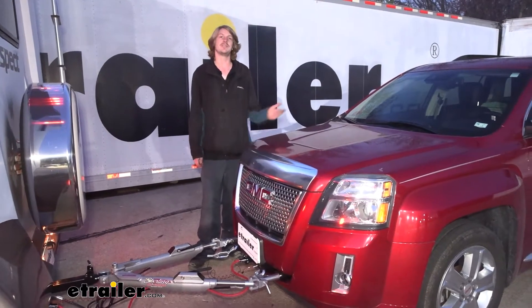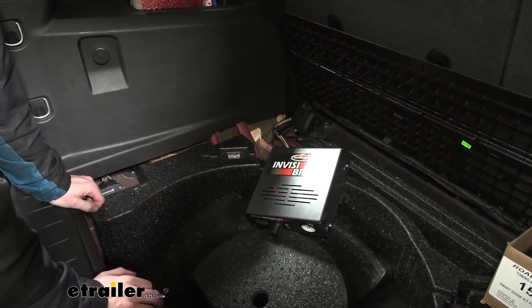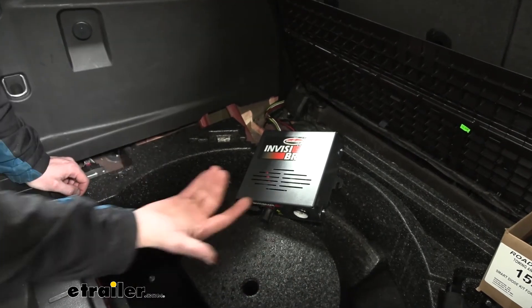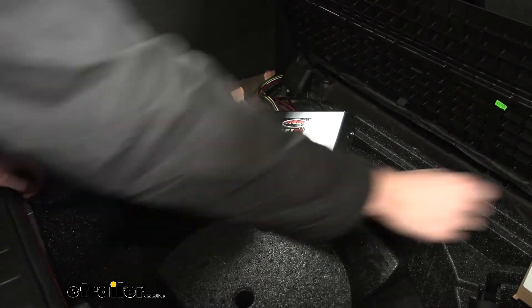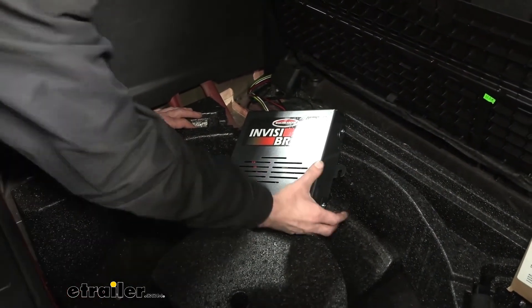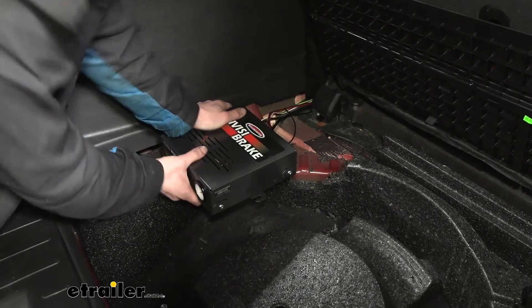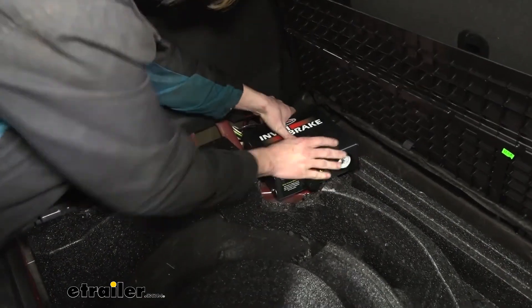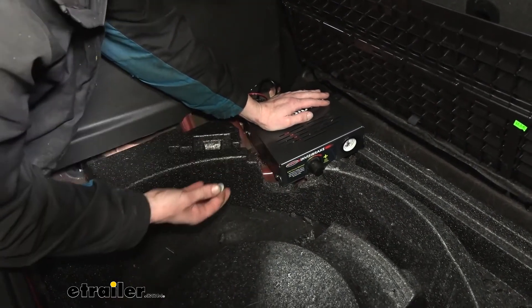Now follow along in the shop to see how to install it. We begin by mounting major components at the back of the vehicle with the liftgate open and the floor cover pulled up. The spare tire lives underneath — we moved it out of the way using the single bolt that holds it. We cut out some insulation in the corner so the unit could sit right down in there, then used a factory stud in the floor to secure it.